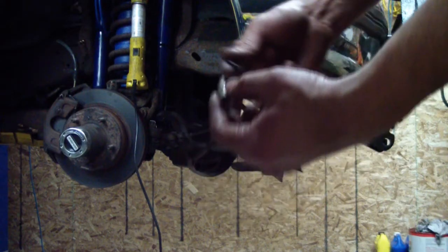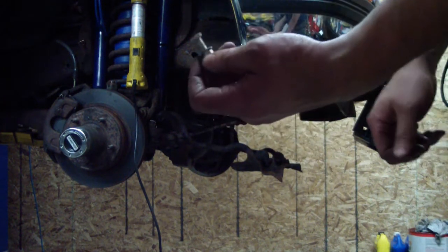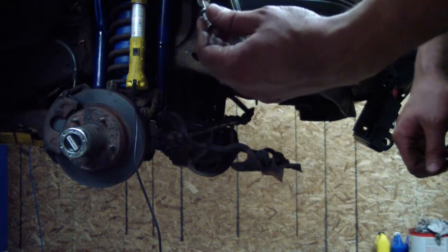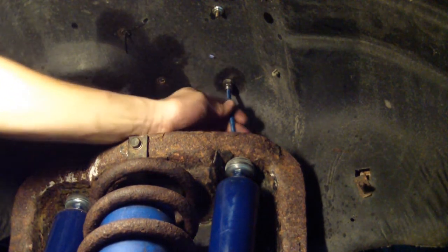Here's the fill valve. I'm going to go ahead and put a couple washers on there. Drill a hole. Each side has their own fill valve, and they give you plenty of tube to install these wherever you want. I chose to put my fill valve on the top of my wheel well. Here I've made a little coil of extra air line, and I'm going to plug that in.